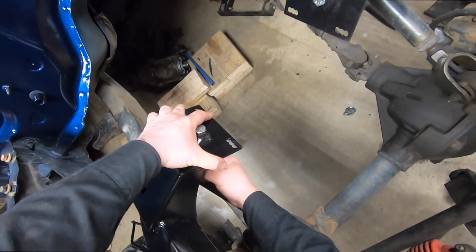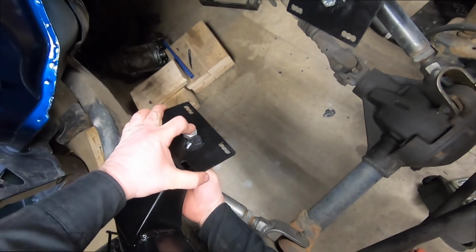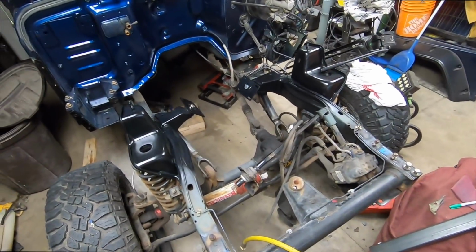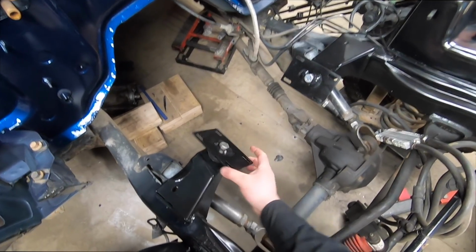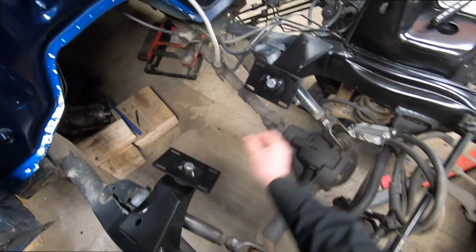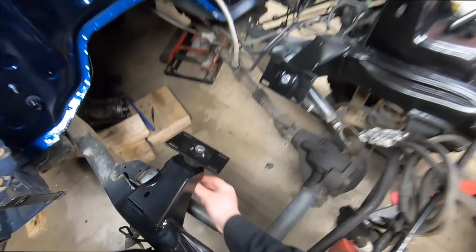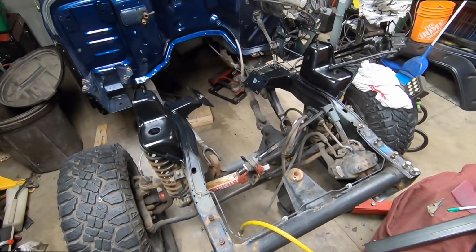And that way, it's got some play. If I need to move it, tighten her up by hand a little bit to set the engine in, then we're gonna be golden. So basically right now, when I drop in the engine, I got some play. I can rotate it with the keystock, and then once it's bolted down, I can get a wrench underneath, tighten it up. That's my hack. We'll see if it works.